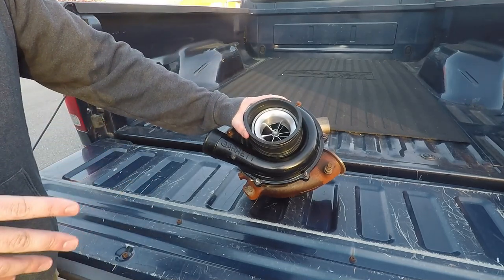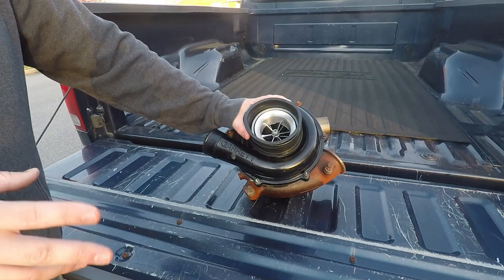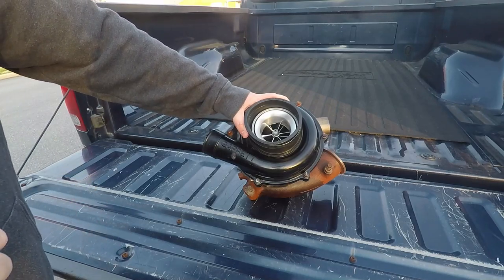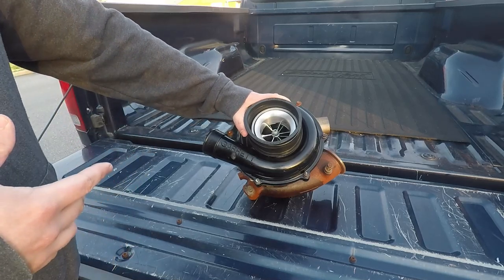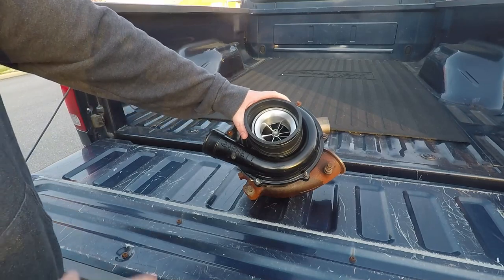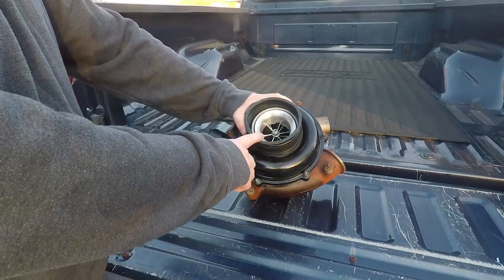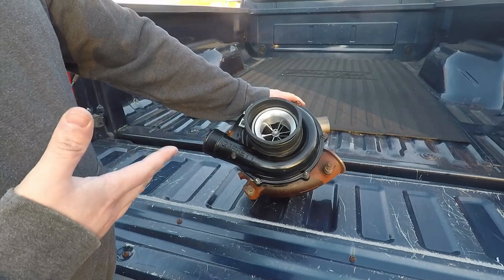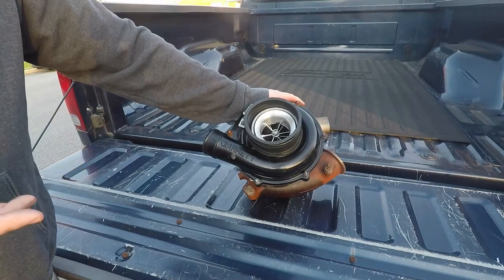For the GXR series, to really take full advantage of that turbo you should be running something like a 190/30 — a 205/30 would be an excellent injector. You can go bigger, but that should really be your entry point for that size turbo. A lot of guys want to run it because it's their premier turbo, but unless you have enough fuel you're going to create parasitic loss going to such a big turbo without enough to drive it effectively. It's not that you can't run it — I'm running 175 stock on a 66 millimeter — but to really take full advantage you'd need bigger injectors.